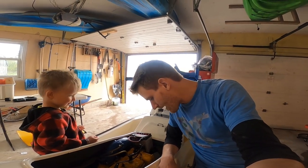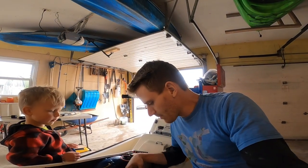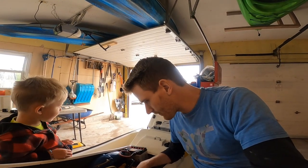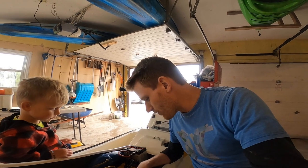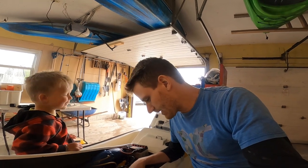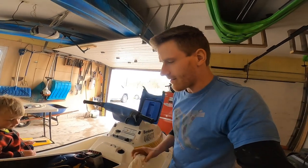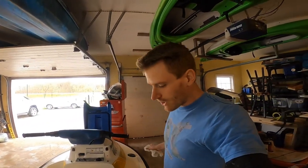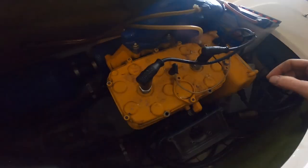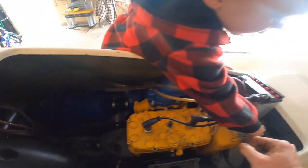So actually, you know what we're gonna have to do next, Jace? Take the carburetor out. Which one's the carburetor? The carburetor is right underneath this. We're gonna take the gas tank out and drain all the fuel. It's probably 10 years old, very old fuel. And then we're gonna take the carburetor apart, see what's going on inside, and probably order a carburetor rebuild kit. What do you think about that? Good. And then I guess we'll get new spark plugs while we're at it. Then we have to take this thing out.